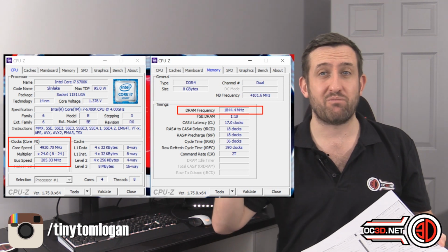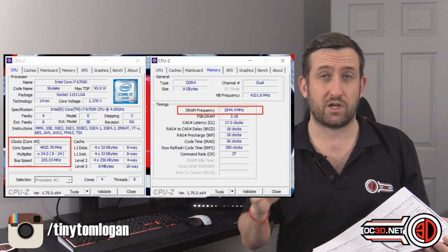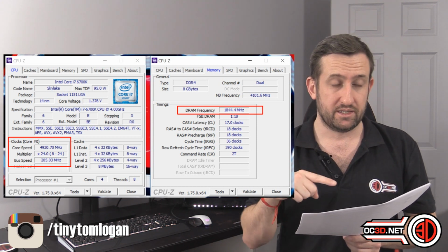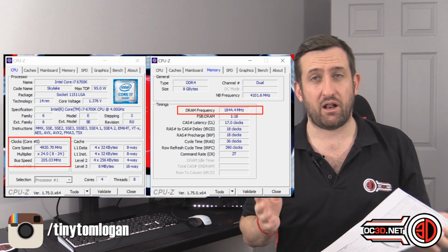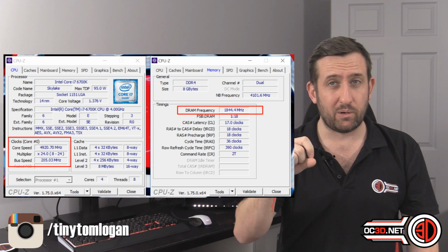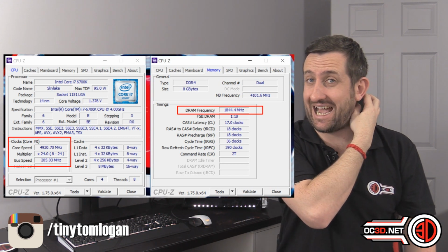I personally think that the memory had more to give us because I could have slackened the timings off a little bit more and spent a little bit more time on that. If I turn the memory divider down one, I could get the bus speed up to 210. So we were getting close to the 5 gigahertz mark with that one. Actually, no, I believe it was just over the 5 gigahertz mark, but it wasn't stable. It needed a lot more tweaking. But again, we were running that at volts lower than we've had other boards do 4.8 gigahertz.